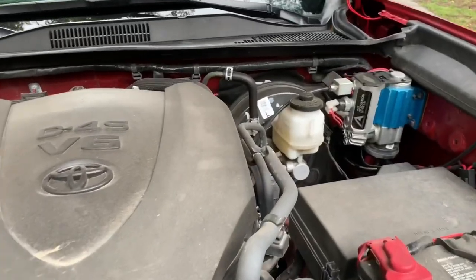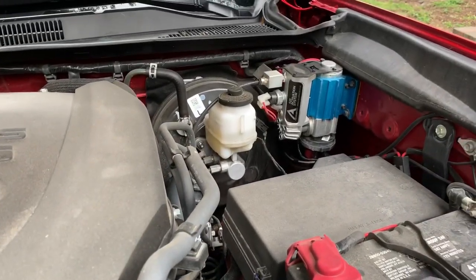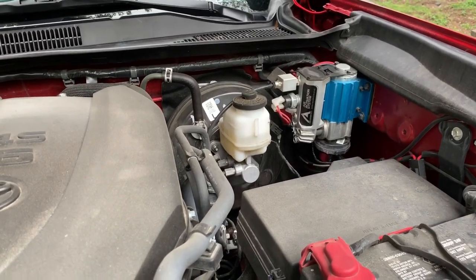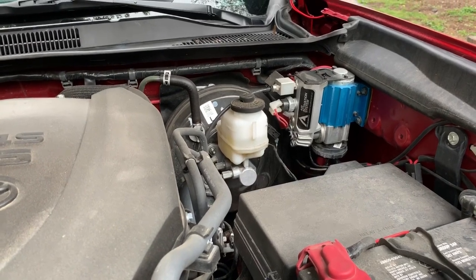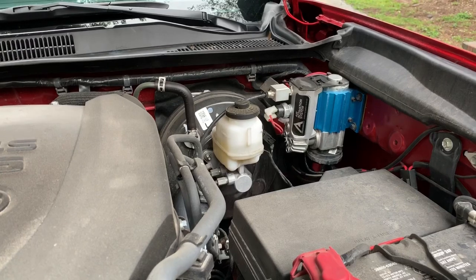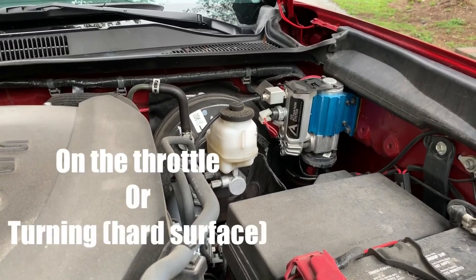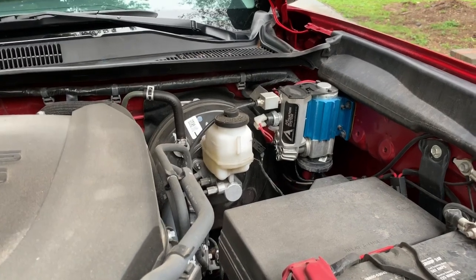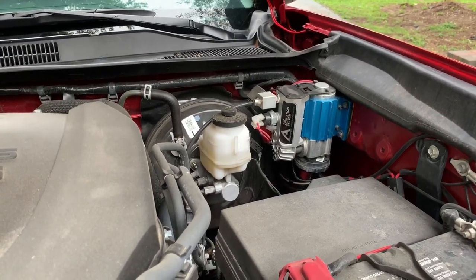Like I said, flip of a switch, you can turn the compressor on, you can turn the locker on in any gear. You can turn it in neutral, you can be in drive. They do ask that you stop before you turn it in — it's not meant to be shifted on the fly unless you're not giving it any gas. I usually put it in neutral and shift it in, or if I'm in park, just sitting there for a second, I'll flip it on.